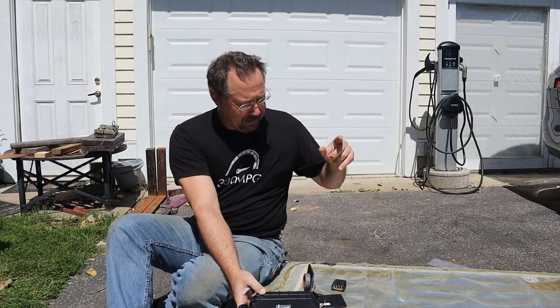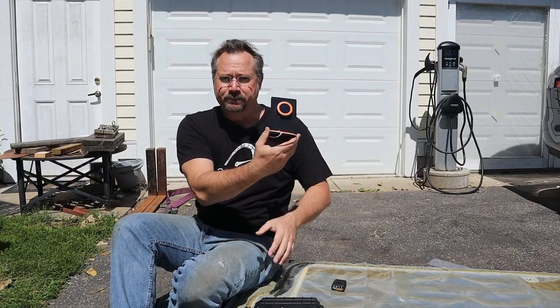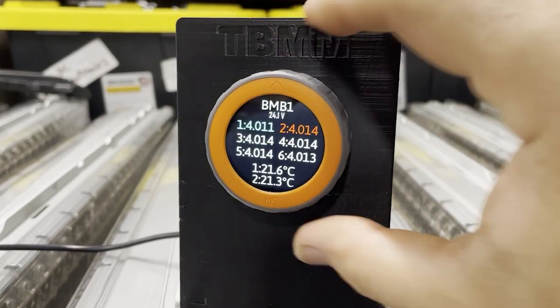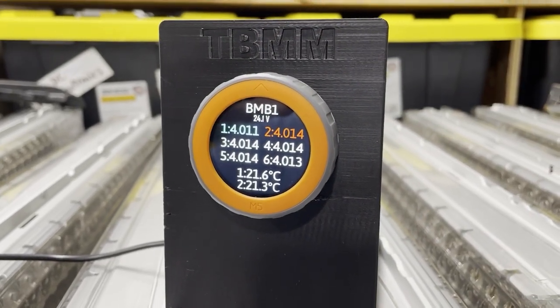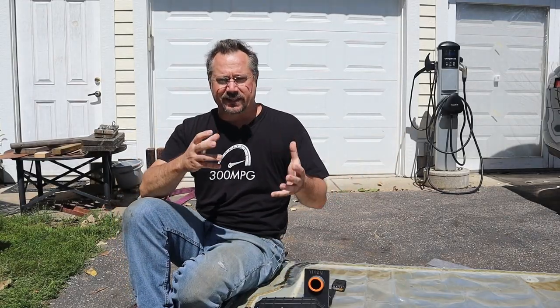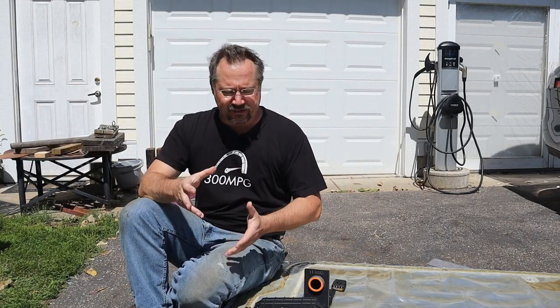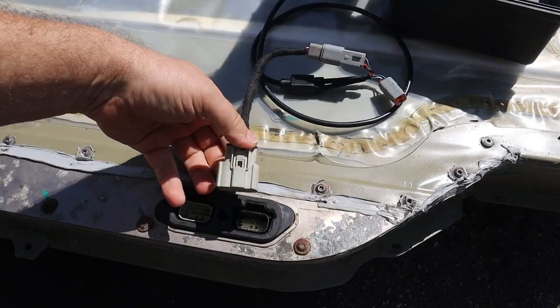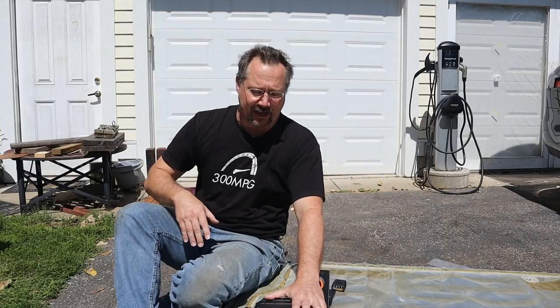You might remember a little while back I tried out this device, the TBMM — neat little doohickey. It lets you connect to one cell module, one hunk of the battery at a time. But to do that, you have to have not only the battery out of the car, but also the lid off and take it apart to get to individual modules. The whole idea with the Tesla Pack Monitor is it lets you do the entire pack at once without a car, without having to take off the lid, just connecting to the low voltage Rapid Mate connection that's already on the car.